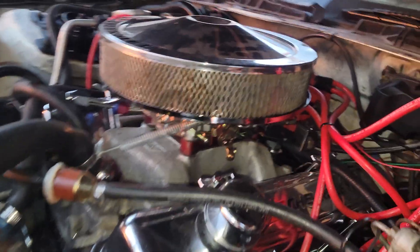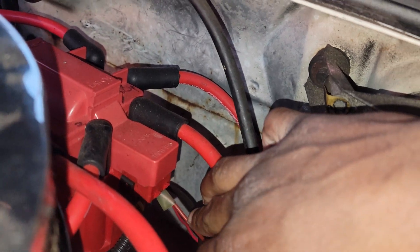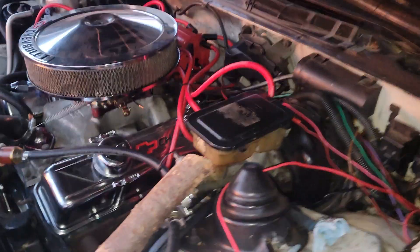I think what happened was when I wired the temp gauge, I ran the ignition wire underneath a spark plug wire, and maybe from the spark plug wire moving around a little bit under the hood while driving, it knocked the ignition wire out. The ignition wire is easy to come off the distributor for some reason — it's like it doesn't come off easy when you pull it intentionally, but with just a little pressure it slides right out. The spark plug wire probably knocked it off.